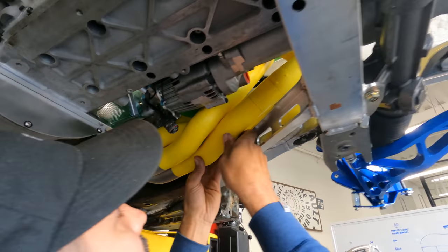So these are the sway bar arms, and they all come in, well, Dom already trimmed this one down, but they come in steel and aluminum. They come like 20 something inches long, so then you cut them down to what your length is, and our length is probably gonna be about 9.5, 10 inches.